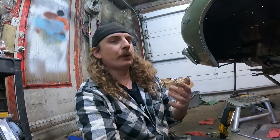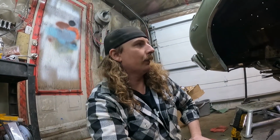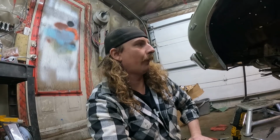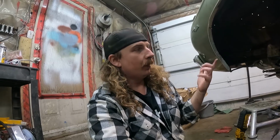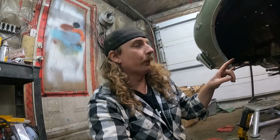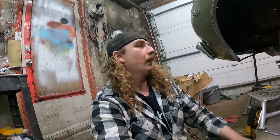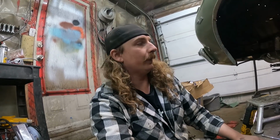It's kind of nice compared to a Chevy. You can just loosen those torsion bars, and then there's no fear of dying because there's no load on it. So I just counted the number of turns I did out. Came out, no big deal. I'm going to give everything a coat of penetrating oil tonight on the other side, so it'll be easier to deal with tomorrow, and take it all apart. Once that's all done, undercoat the inside and stuff like that.